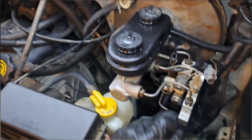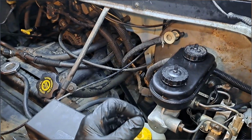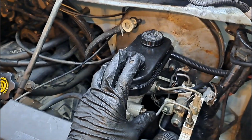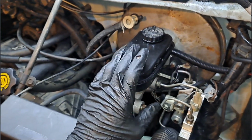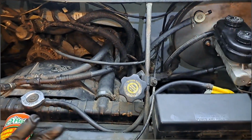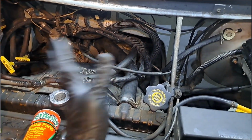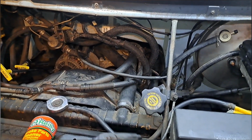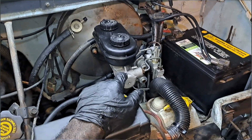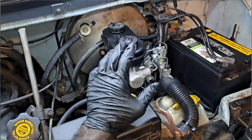But it drives. I mean, it works perfectly fine. It just can be better. That's my feeling. So we don't need a master cylinder. I did fix all the leaks, showed you that. That's fine, and we're in good shape. So I'm gonna keep you updated and let you know what the owner decided to do. If I don't do a video, then I'll definitely update the description with the status of the vehicle. It drives fine, no leaks from the intake gasket and things, and I replaced the wheel cylinders. They were leaking, and I spent several hours checking this brake system. So I'm just going to let him test drive it, and I'll update the description.